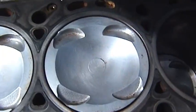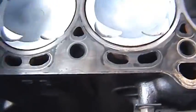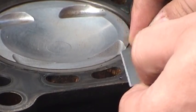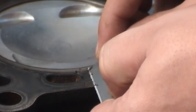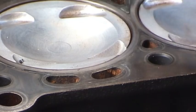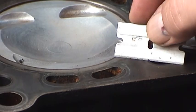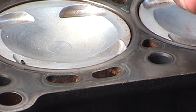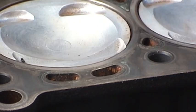Now I have all the pistons cleaned up. Next is cleaning off the mating surface with a razor blade. What you want to do is just try and get underneath this little black gasket material that's all over the place, as well as any oil gunk buildup. You must get all of this black gasket material and oil and any impurities off the surface. Don't dig in, because even the slightest little scoring from a razor blade could be a potential cause for leaks down the road — not immediately, but years down the road when things start to break down. It will find those little score passages where you potentially scored the block.